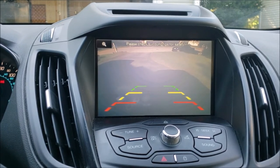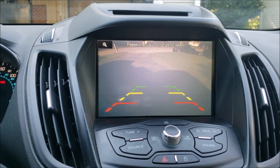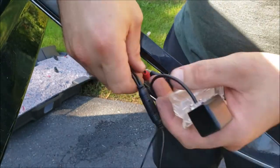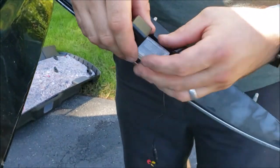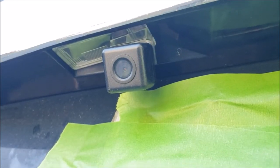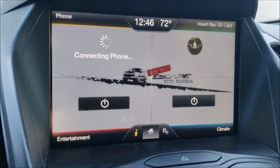I'm going to swap out the old camera for the new one and show you what it looks like brand new again. Because we already have the installation video for this process posted on our channel, I'm going to go over this pretty quick. You pull off the interior panels and then remove the four nuts that hold this trim panel above your license plate. It'll come free and you can install the housing and run your wiring in. We have our new camera installed, and I'm going to show you what it looks like brand new.